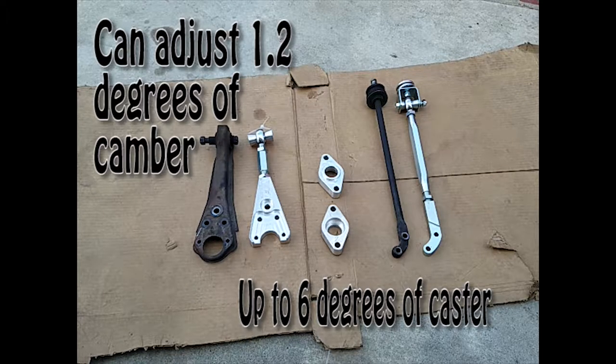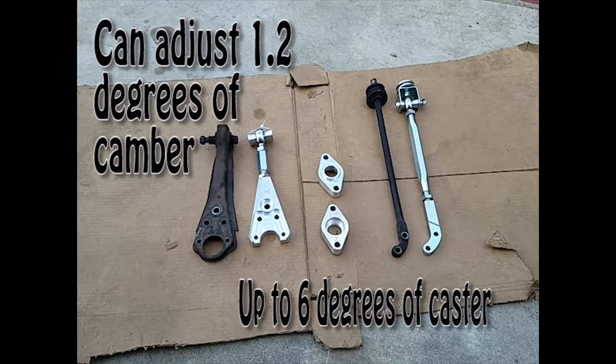Beside the lower control arms and the tension control rods, you can see how they look a lot beefier and they're fully adjustable. So now I'll be able to adjust the track width, also the camber, and with the TC rods I'll be able to adjust the caster.